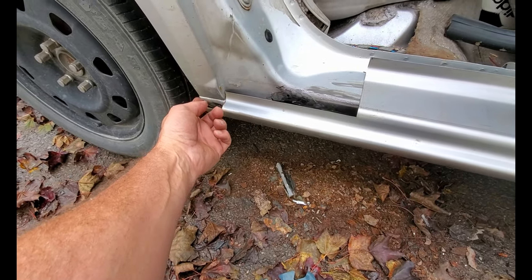It's going to be a little tight under that door. The door is sitting a little low — there's no gap under here, not enough room to put a piece of metal underneath this door. So I think I'm just going to weld down this seam, and I'll be able to butter that into that radius. I should have enough room to taper this off in here somewhere and not have to deal with that low spot on the door.